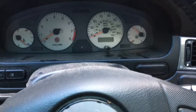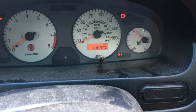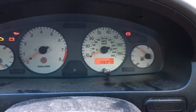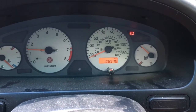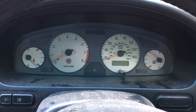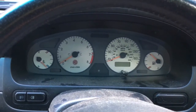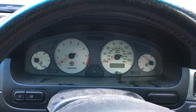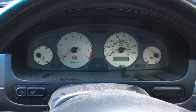It does seem to work loose now and again. Make sure it's fully pushed home. Now we can see the SRS light goes out — you only need to put the ignition on to confirm it. Start the car and it stays out. So that's a simple solution if you've got your SRS light on, which is probably an MOT failure, so worth doing. Very simple fix, only takes five minutes. Thanks for watching, hope that helps somebody.